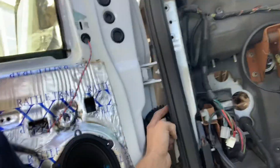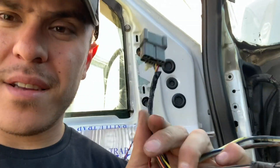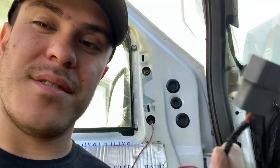I think '07s are going to be a totally separate video. Now, '99 to 2006 — most of you are okay. Most '06 guys have the old setup, which is good. We can leave wires through these doors all day. So just tell me what you've got. This guy only has adjustable mirrors — no heat or turn signals — so that's something we'll have to add to his harness.